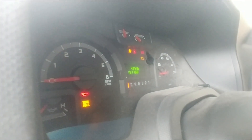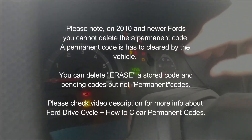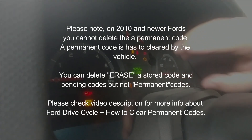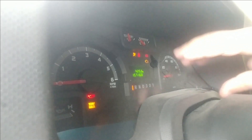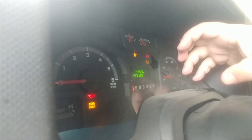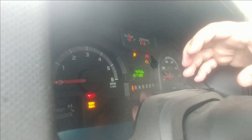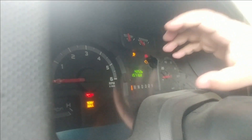If you guys actually need to complete your Ford drive cycle monitors, I have a video in the description box below. Whether you have a Ford or a GM, I cover every single make. Also, there are going to be permanent codes — so if you have a 2010 and newer vehicle like a Ford, I'm going to have a video link in the description box below on what a permanent code is and how you can actually reset that. A regular drive cycle is not going to help you with a permanent code — it's a more involved process. This only applies to 2010 and newer vehicles, and this drive monitor check can be used on any Ford 1996 and newer.